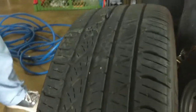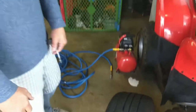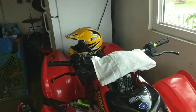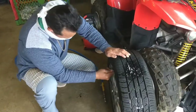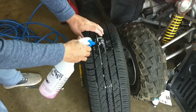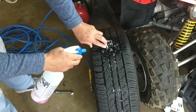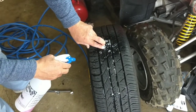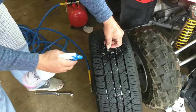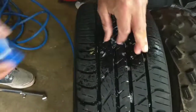So you get that plug in real deep because you need a lot. I don't know about that. That's how you fix it — then you just cut this off right here and see if it holds air. Let's see if that works. 35 pounds of pressure — that's not enough but we're doing a test. You do a test with water and soap. You see there's no bubbles, so no air's coming out of it. It's sealed. It worked.